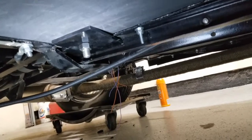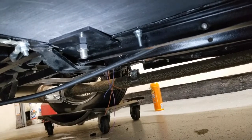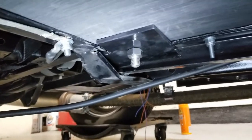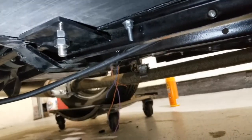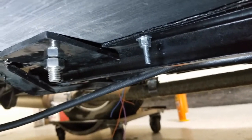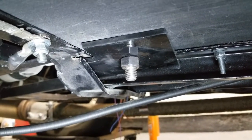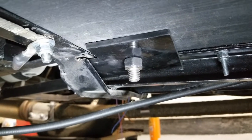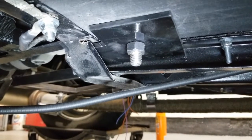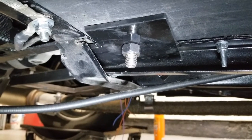And that's how it looks. MGAs did not come — well, mine didn't come with a seat belt. So I have rigged this in like I said. You can see it's nothing more than a big washer, a plate that extends both to the floorboard and to the actual frame itself, and goes through that portion there. So it's both wide and long, and it hangs on to two axes worth of frame. I actually need to drill the other side and do the same thing — it won't take me long to do.